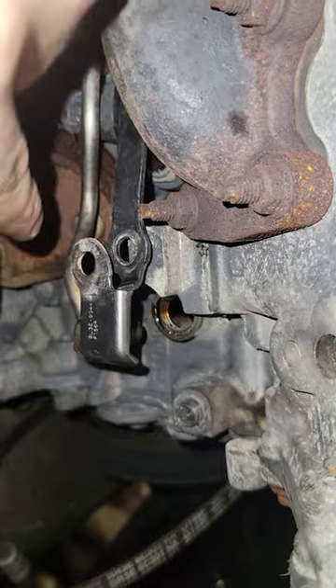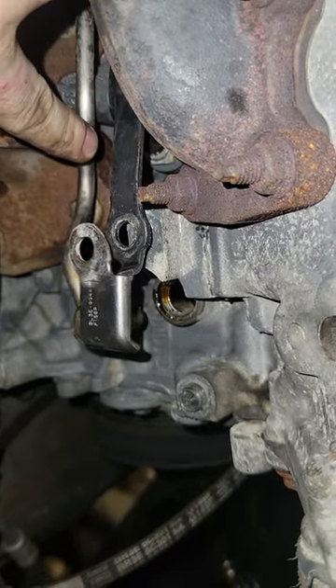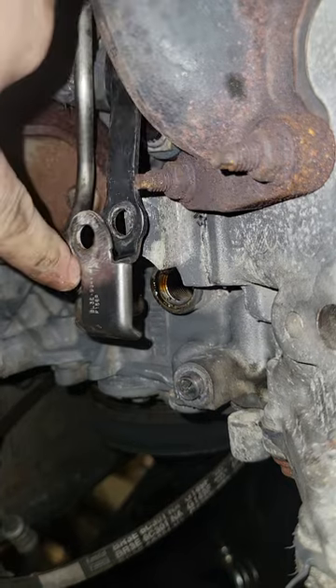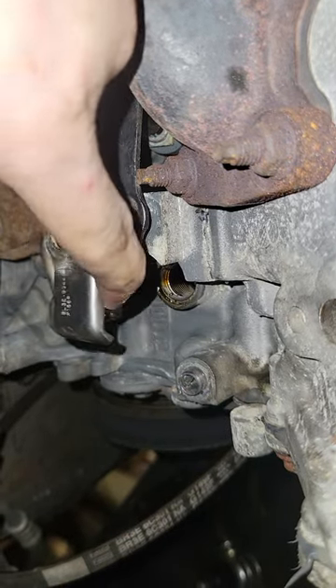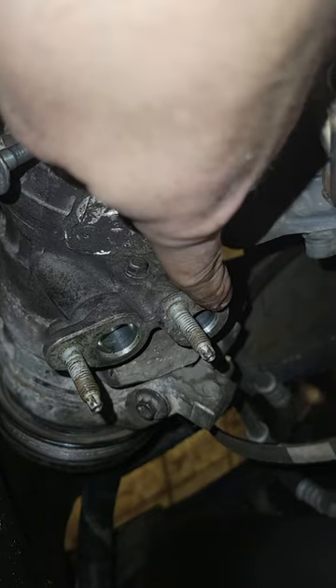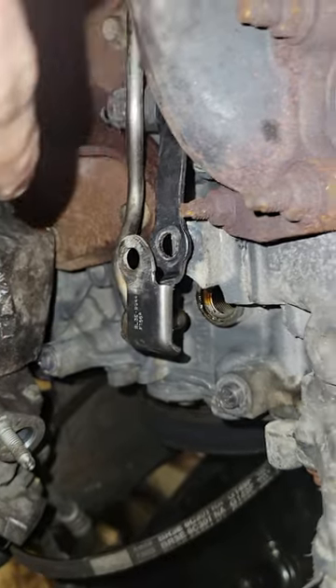What you've got to do is take this bolt out — and that leaks a little. I think once I put pressure back on it, it'll be fine. But this is on the inside, so I just pulled it out so I can get the fitting out. In order to get to this, you've got to take your AC compressor off. You've got to drain your lines, recycle them, and then you take your three bolts out — this bolt, that bolt, and the top bolt. Don't use an electric ratchet — if you use an electric ratchet, it'll get stuck between the frame. Tell me how I know, because I just did it.